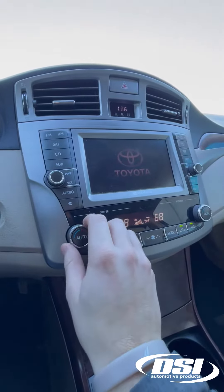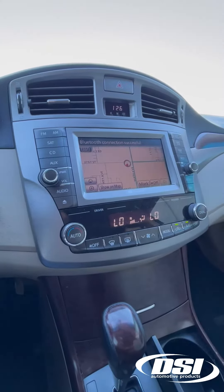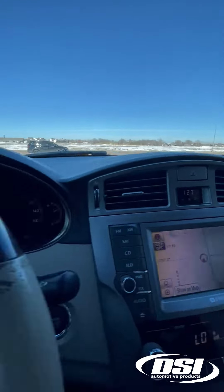You may then start your vehicle and turn on the air conditioning system. Set your AC to low temperature at a medium blower speed with the internal circulation going. Ensure that all the face vents are open and then let your vehicle run for five to ten minutes.